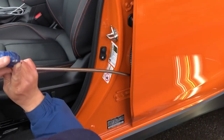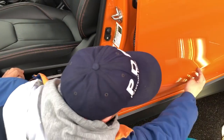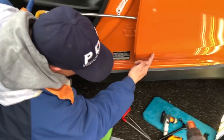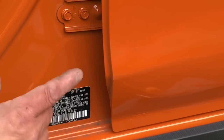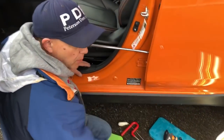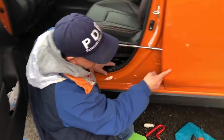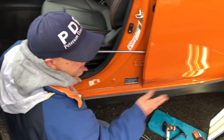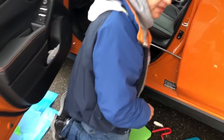That was a strong push, going through the middle making some more pushes. I'm going to clean up the rest of this body line with Bertha and then come back in with a little hook to get these guys out while tapping down some of this stuff. I did tap down this little high brace that was sticking out — that tapped down real nice. There's still a little bit of residual there, but now that I have the board at a different angle I can see it better. Stick around for the last little part.